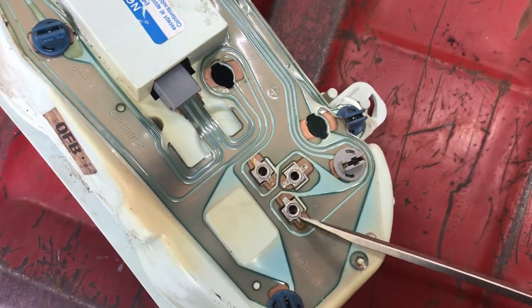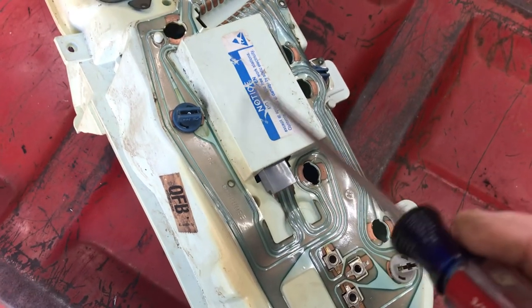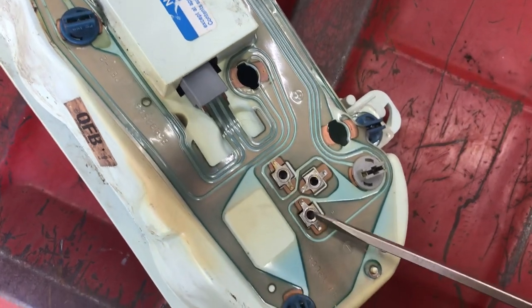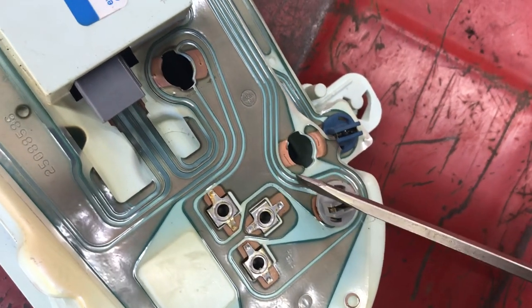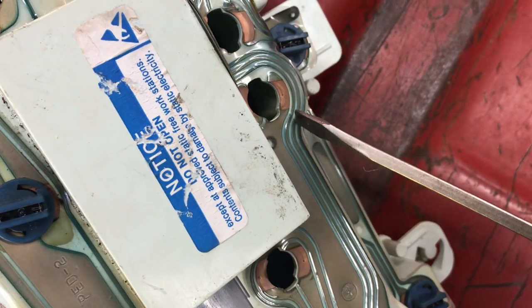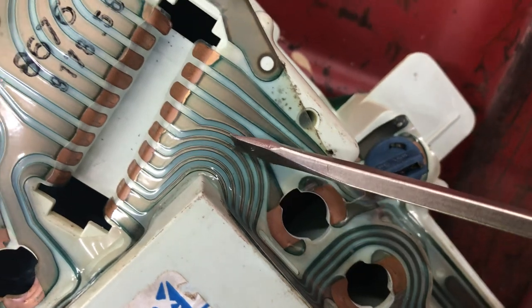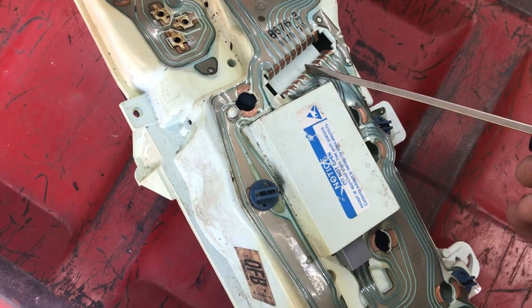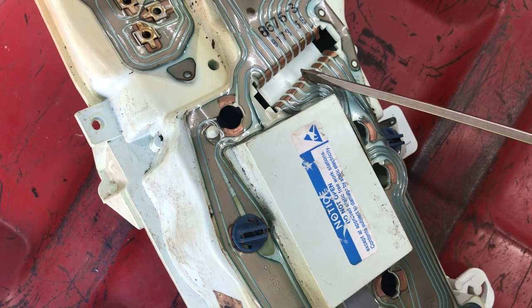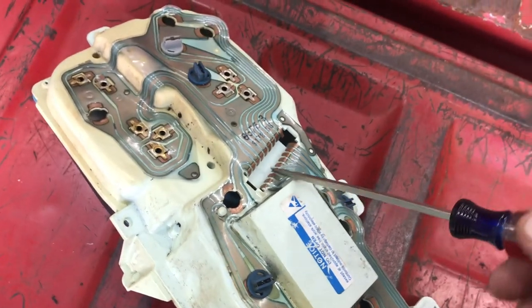This is for your gauge wire on this particular instrument cluster. On this truck, this trace ran across the top — this one's a little different; it came out of a dually truck, so I've just used it for parts. You can take and trace that around — it's kind of easy to lose your place. Right there is going to be your wire. I think it was 87 or 88 they went from a pink wire to purple for your fuel gauge — don't quote me on that — but you can trace that, figure out which wire is plugging into your instrument panel, and just replace that whole wire; I've had to do that because it was broken somewhere and I couldn't find it.